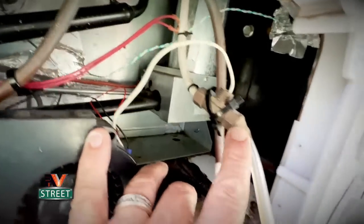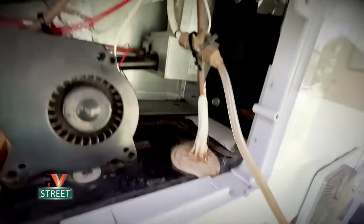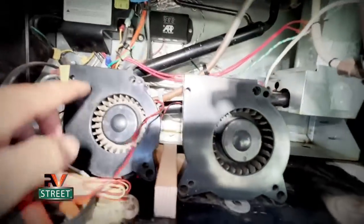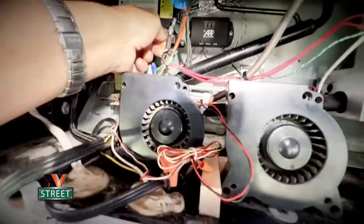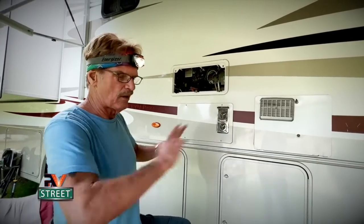On the other end of this fitting I ran more tubing. So now during the day, when it powers down and starts to somewhat defrost, this water just comes and drains right through this tee and drips out on the side of the motorhome. And this wire right here ties into the 12 volt on the control panel up there, so it has constant 12 volt and can be running all day long. This is the control box up here and you can see that I've got everything disconnected — the AC plug, the igniter wire, and the 12 volt — because this unit has died and it was leaking ammonia. When you have leaking ammonia, you not only know that the refrigerator has died, but that's how fires can start. So if you ever have your absorption refrigerator starting to leak ammonia, just turn it off right then and there, unplug everything, and don't use it again.